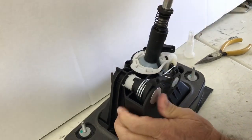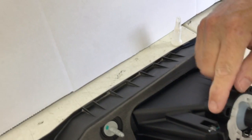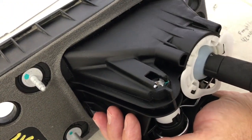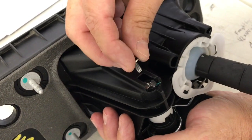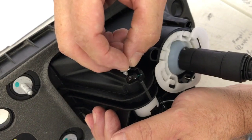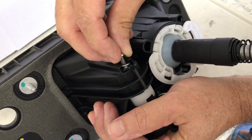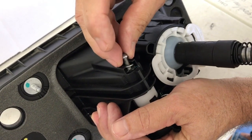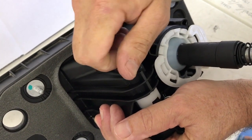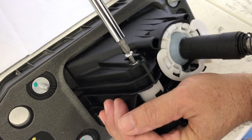Just push it in, and on the passenger side you can see the pin there. We have a little Phillips head screw — it's going to have loctite on it. You want to put the washer down near the tip, then that washer slips in there, and with your fingers you're going to get it started into the end of the super pin and then just finish it.